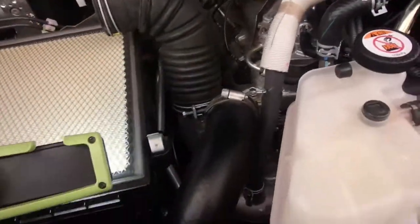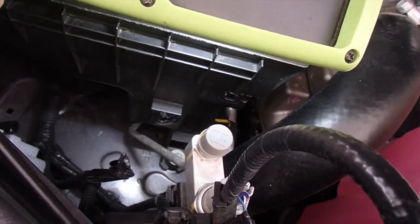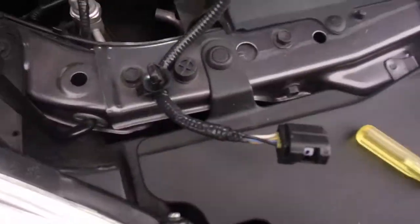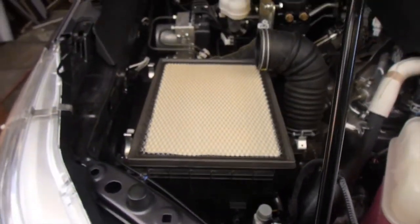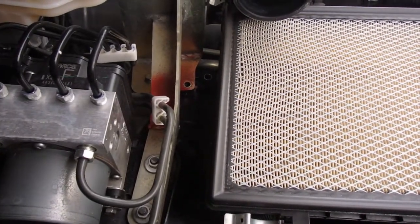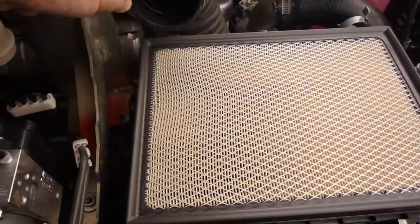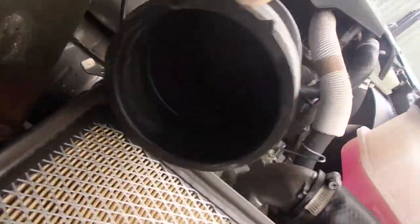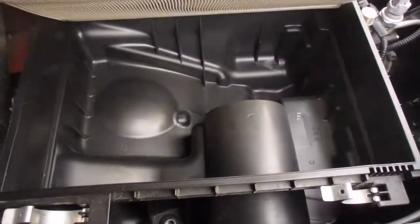Then I can lift this section off and unbolt the base. That was a bit fiddly — the clip at the base is on a 30 degree angle. The mass air flow sensor lead is up and disconnected. I only had to remove the three bolts and didn't have to back off my 30 micron pre-filter. The unit's free now. The pipework is nice and clean — it's a good idea to keep it in check on these Toyotas, especially if you're operating in dusty conditions. Inside the air box is perfect, which just goes to show that having the intake semi-sealed isn't that bad an option.